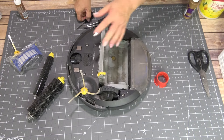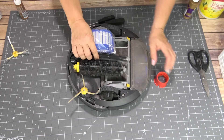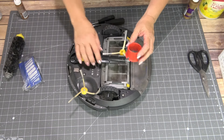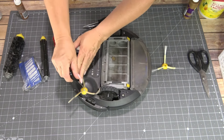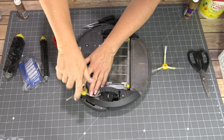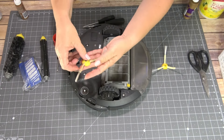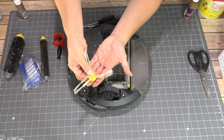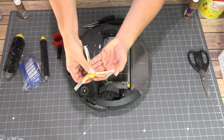I'm going to give myself a new beater brush. You can get a full kit with filters, a new brush, the roller, and the cleaning brush. This whole set comes for about $12 from Amazon. I replace it once or twice a year depending on how much I've used my Roomba, but this tool especially is the most useful thing in that kit. All you have to do is get that little screw right out and it pops up. After a while you can see the shape of it — it started to go sideways, so when it's spinning it's not collecting the corners anymore.